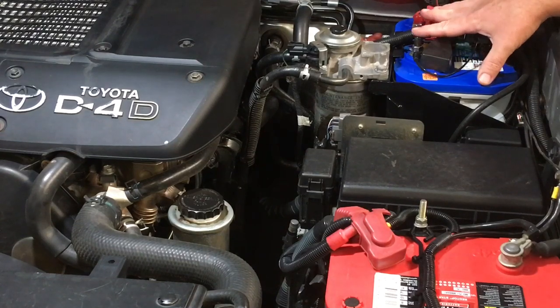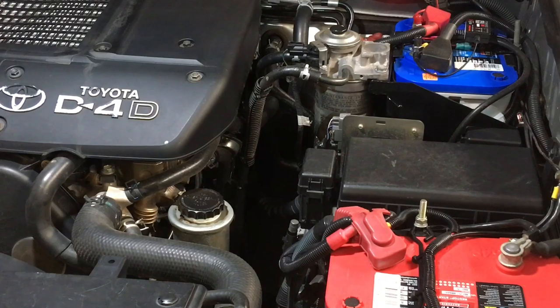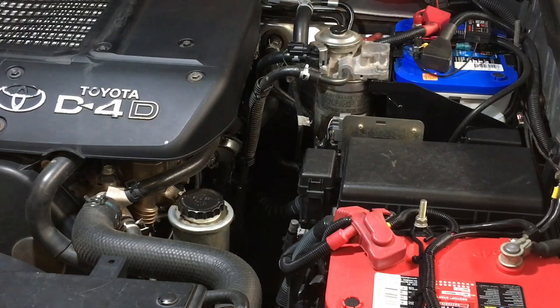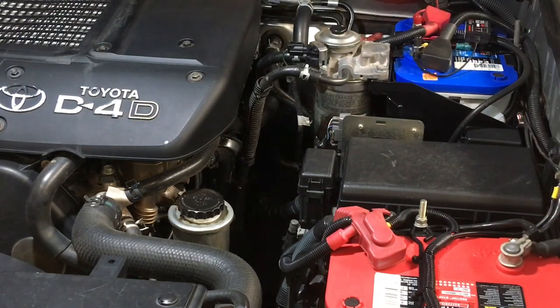The battery has to be secure — that's important. That's the battery of choice for this vehicle and I think it would suit most people's needs given the rest of their setup is right. Here we've also got the D34 red top — the red top is your cranking battery, you cannot use these for deep cycle, you'll wreck it. Therefore you don't want to connect anything to it that's going to put a drain on it.